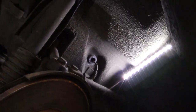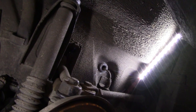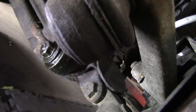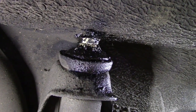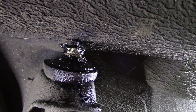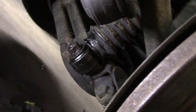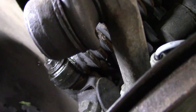This is probably going to be a little bit dark but at the front of the car you can see the stock Spica shock that's original to the car. We're after the lower bolts - that's a 17mm wrench on that fitting - and then the top shock fitting has a jam nut and a lock nut, both seem to be 17mm as well. I've sprayed penetrating oil on the top and bottom a couple of days ago and let it sit in preparation for this job.